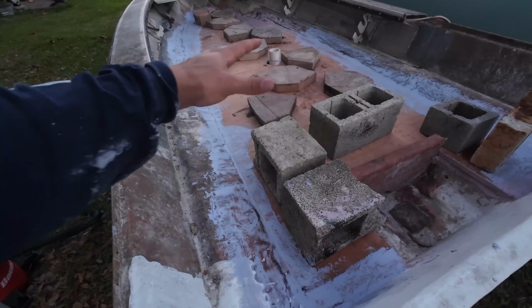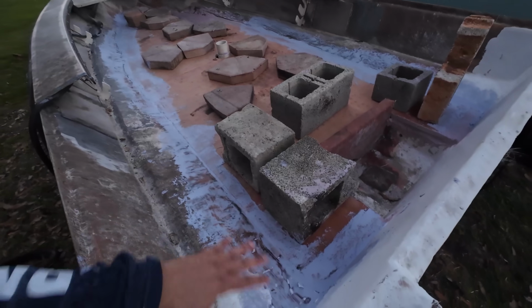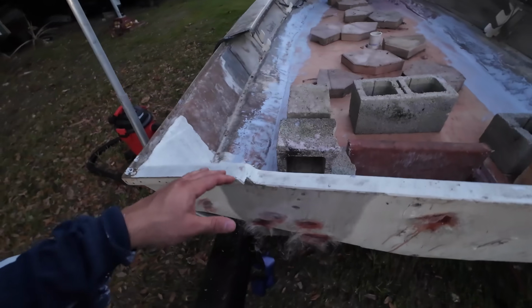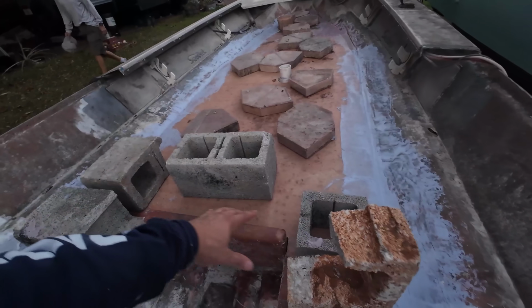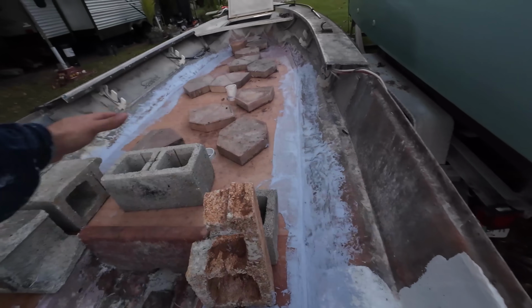All right, I got all the weight, and I got the deck down, and I tried to fill the gaps in with some of the FCA putty and the vinyl ester putty. So now all we have to do is wait for this to cure. I'm going to come back tomorrow, sand the deck, and then we're going to start laying our glass. We're going to do 3 layers of 1708.